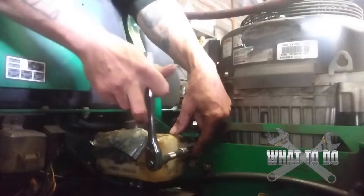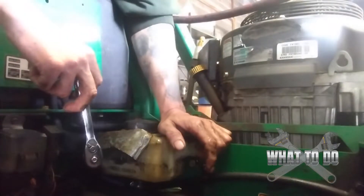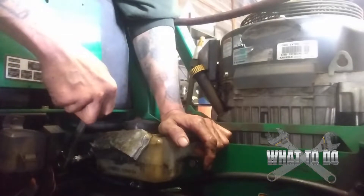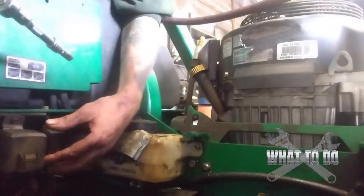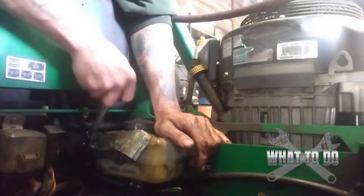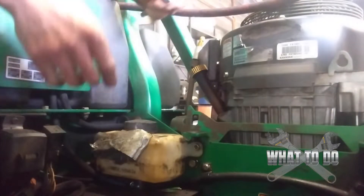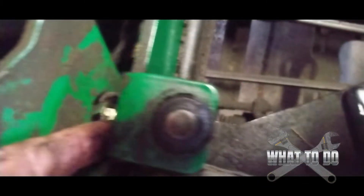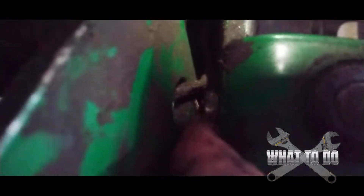This one's pretty accessible — your 8 millimeter — you can just ratchet that off. This one over here you kind of have to snake your ratchet drive in and down the side of it. There's not a lot of room to get air tools in there. You have some fuse blocks here, but you can take your ratchet, go straight in and then turn, and you can get right back in there to take that one off. I already loosened them for the sake of speeding up the video. If you're having a hard time with the nut spinning on the front, you can just hold your hand back here — this bolt will pretty much hold itself in place.